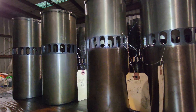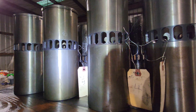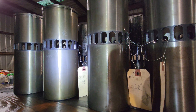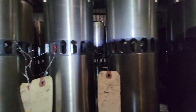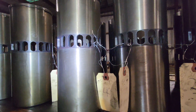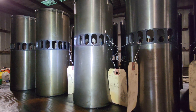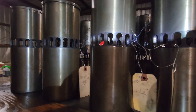Used tolerance is two and a half thousandths, but these are zero to one thousandth — they're snug. Some of them, with oil on it, you had to really clean the oil off; they're nice slip fits. Number one I'm guessing is zero to half a thousandth, but the rest are zero to one thousandth — that's my best guess. Trying to keep everything the same temperature; it's 50-some degrees today, a pretty good day to work since your oil doesn't get too thin. I'll post more updates later — we're going to take these up now and build the piston sets.